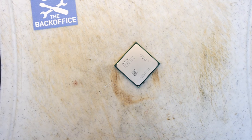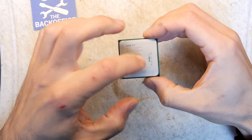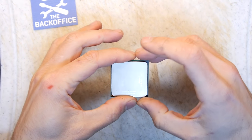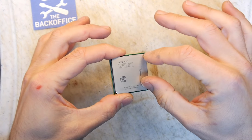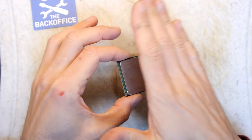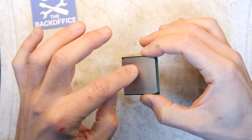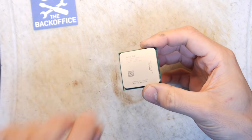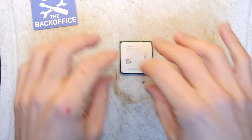So what someone told me was, the problem with these CPUs, or any CPU really, that uses these sort of metal cans on the top, the heat spreader, is that underneath there's chips, but lots of chips, like the cores and various chips, memory management units, things like that. And they've got this metal heat spreader, which is almost like a heat sink in itself, to stop people damaging the sort of silicon when they put their own heat sinks on there. And what can happen, apparently, is that underneath, there can be problems with the material, the sort of Arctic type, silver type material that lives underneath there. And these get faulty, and it causes all sorts of things. Like you'll get one core getting really hot, and the other one's okay.